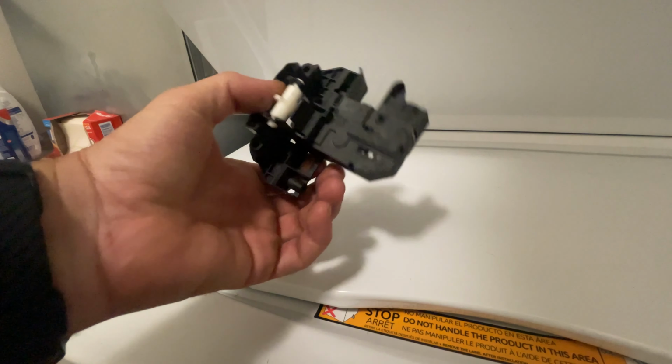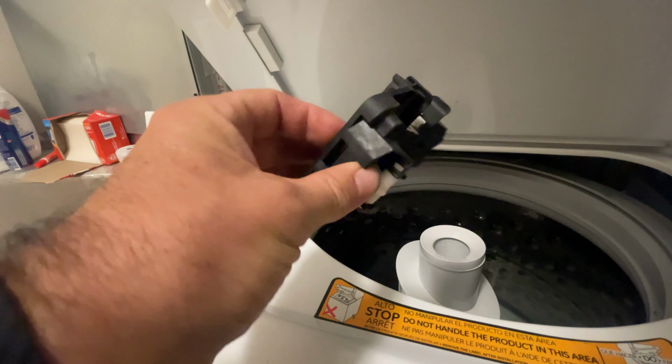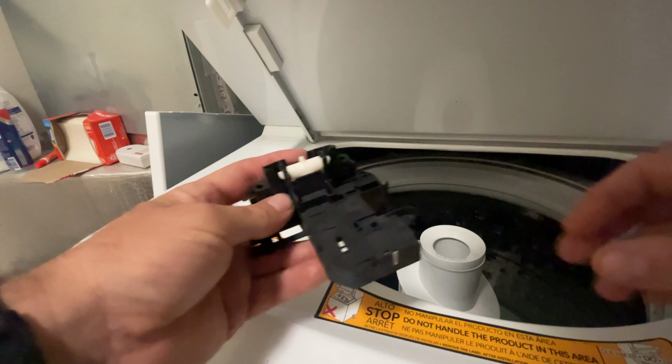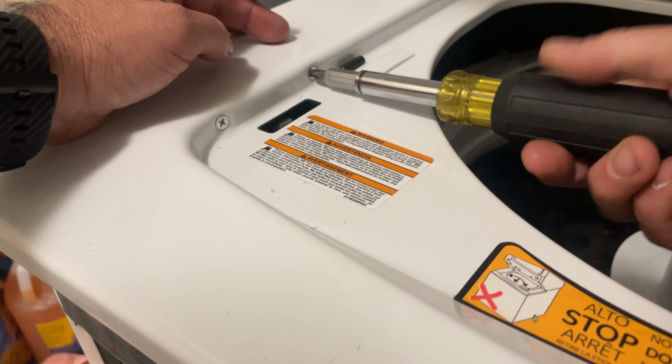I have the lid switch right here. Always check to make sure that your model matches up with the particular part. Don't just go and order this part because I leave it in the description without matching up the model. Always recommend turning off the power when servicing any kind of appliance. This is held in by 2 Phillips head screws.